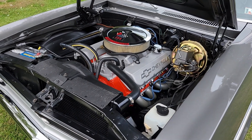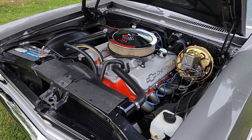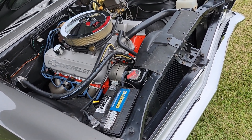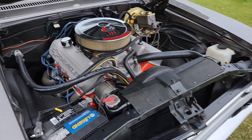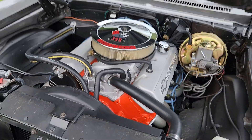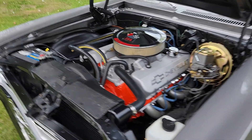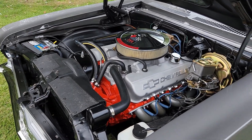So he had an oil leak, pulled the motor to address that, and then we took the flywheel out and had that resurfaced. Then cleaned up the engine and repainted it. Glass-beaded the valve covers because I think he had clear-coated them when he put them on, same with the Edelbrock intake — not sure which one it is, but he has the original one too. The original valve covers and original air cleaner lid — he had clear-coated those, and with the heat and over time they just got yellowed. So I taped off the Chevy script and the bowtie and glass-beaded them.